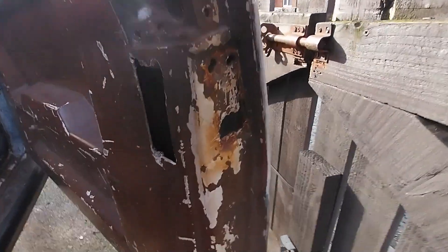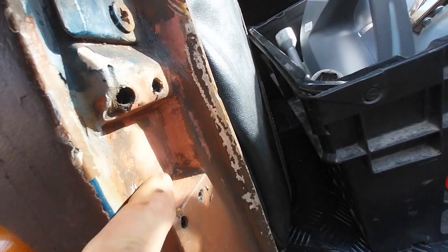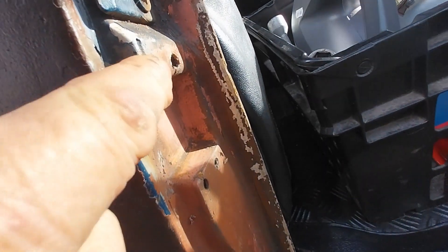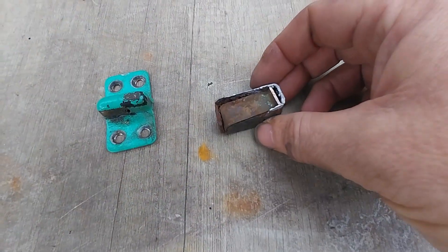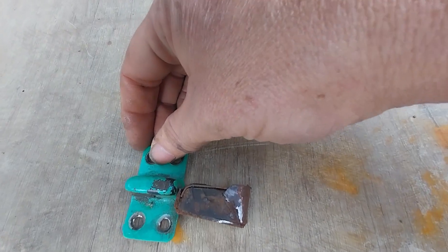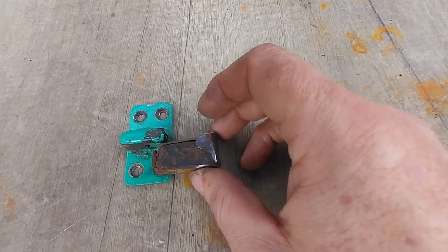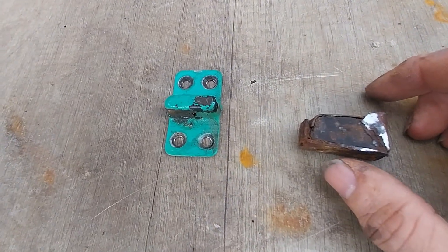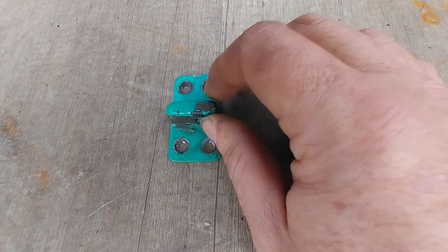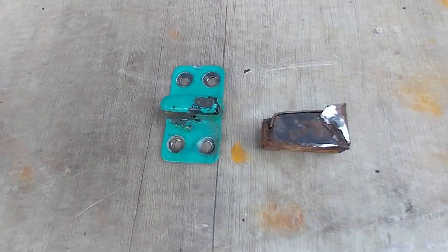What I'm going to do is this. You can see the issue here - all this wants repairing. There's a dovetail joint that goes on there and slides into another part, but it was all rusted beyond repair. This is the bottom part of the bit that was rusted beyond repair - I've cut it in half. All it needs to do is have this part ride along there and just lift the door up a touch. That's off another car. I've got to repair the door and make this kind of adjustable - I can't just screw these two things in solidly, because if it's not right first time there's no adjustment. So it's going to be a bit fiddly.